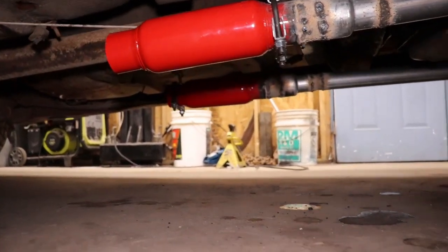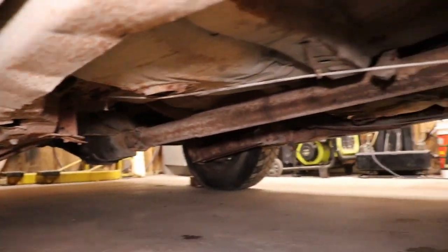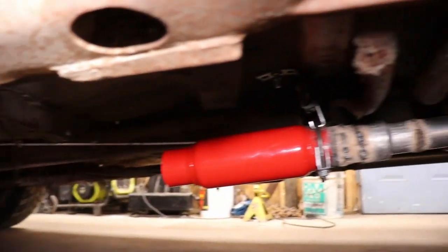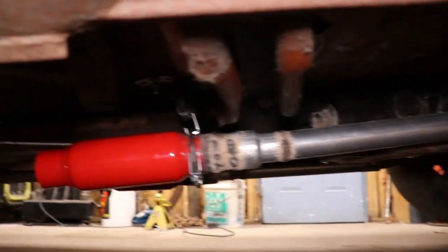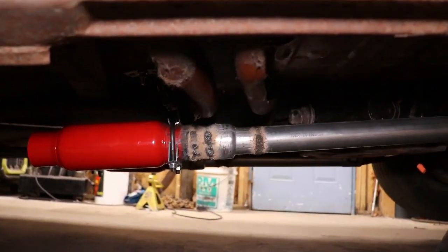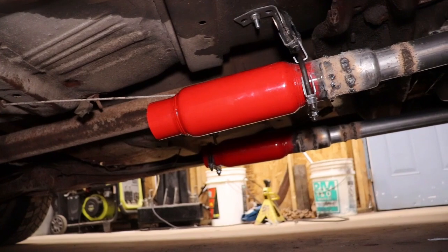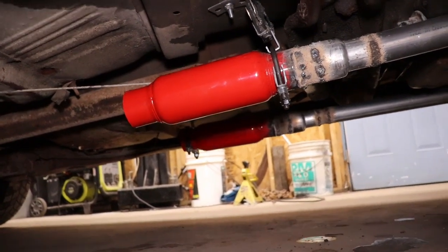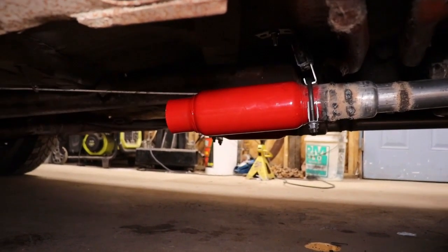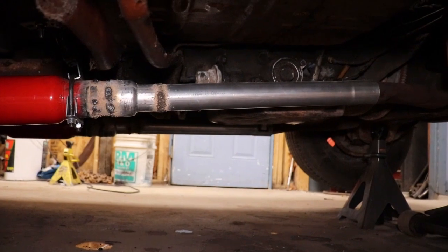So we got to go back there, drop the gas tank, and then run new fuel line from the gas tank to the metal fuel line. First we're going to blow them out up to the fuel pump, and then we'll be moving back up to the radiator, because I had to wait on a flexi hose to come in because I couldn't find the right bottom hose to fit the aftermarket radiator. And once we get that in there, we'll be ready to fire it up again, and hopefully the exhaust sounds quieter than running off straight manifolds, and see if it will even go in gear.